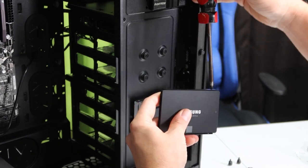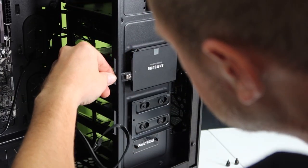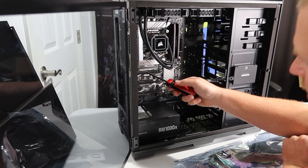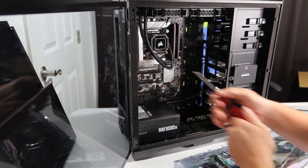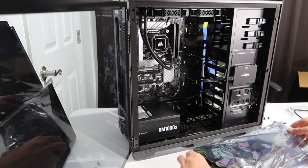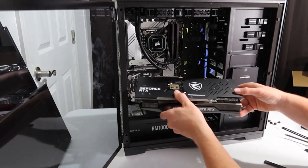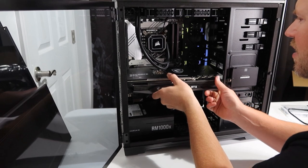Things have changed a lot in the nine years since I last built a PC. Now it's graphics card time. Up here I've got the PCIe x16 slot. I'll remove the two back vents that are available, carefully pull the graphics card out of the bag, remove the protective rubber piece, make sure the little tab on the slot is open, and very carefully press it down into position.